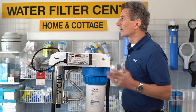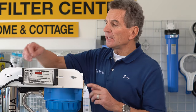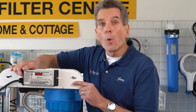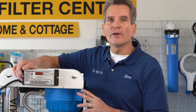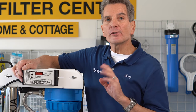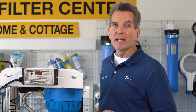That's not a troubleshooting warning or error message — it just tells you that you've gone over. So now on the side here there's a little reset button. You're going to push in that reset button and hold it in. Then take the power cord and plug it in. Once you plug it in, it'll pause for four or five seconds, and then you'll see the word 'reset' show up on the screen. I always wait until I see the word 'reset' and count to five. After that, let go of the button, there's a short pause, and then it'll go to 365 — that tells you the unit has been reset.